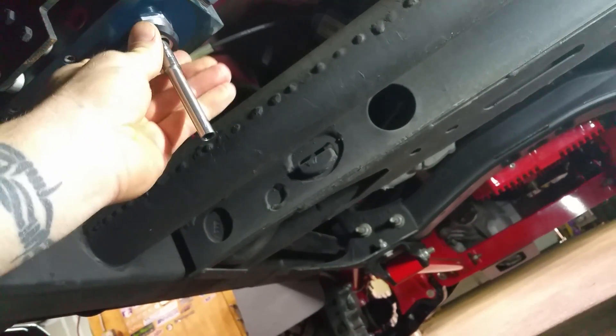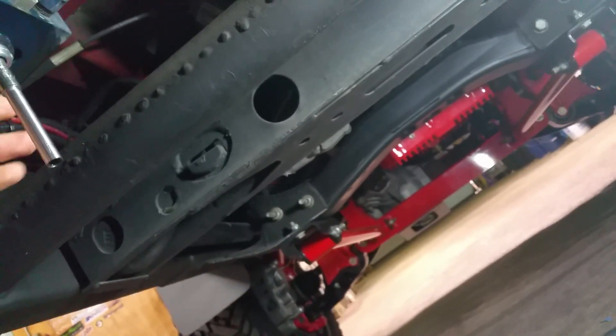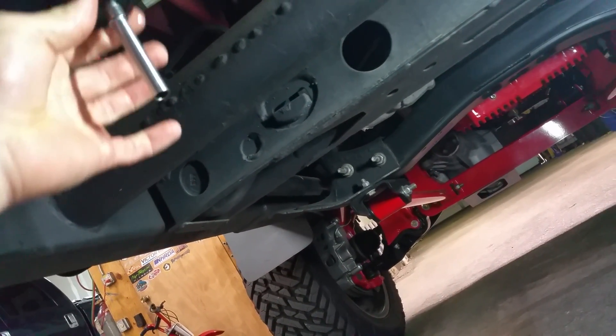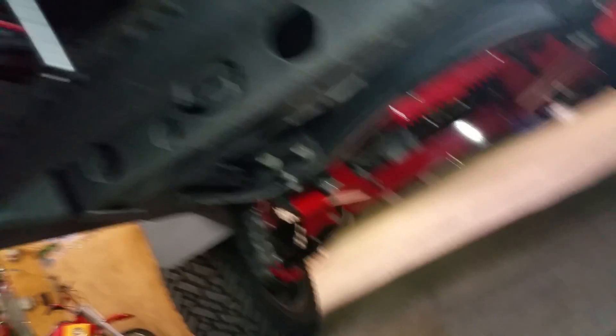This is the older-style titanium unit using the smaller 2001 and the larger 3003 together. The newer ones would be the grey body unit, using the FS-1001 instead of the 2001. This is the little O-ring — you're going to go ahead and place that up here. When they get some age on them, they wind up falling off. This is the one that I removed. As you can see, it's grown from exposure to the fuel oil, and it's no longer able to stay on by itself.